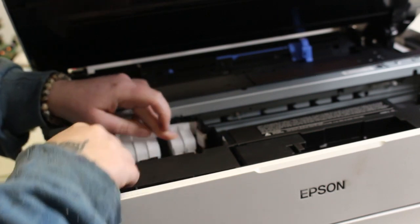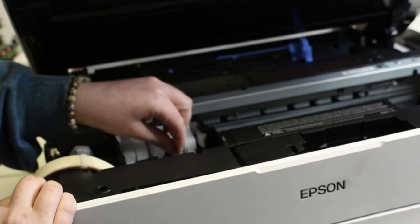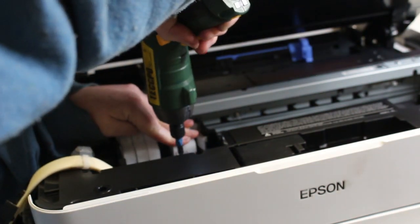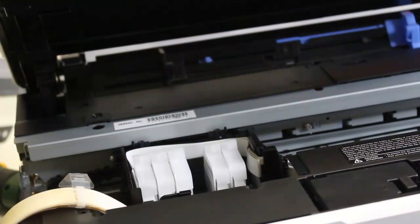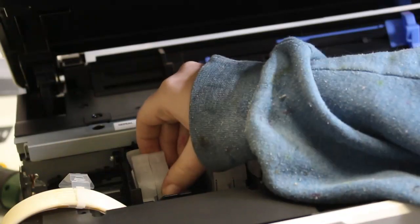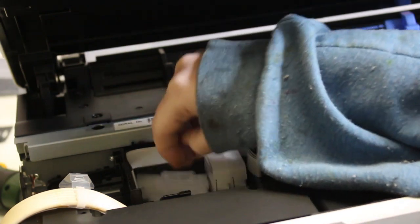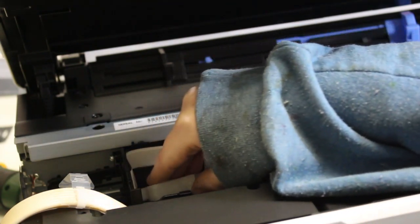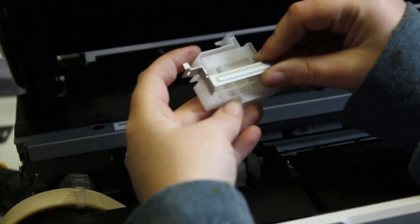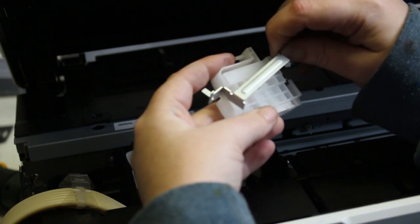Go in more towards an angle towards the back, right? So if you're holding the damper, hold it up at an angle, as if the back is facing angled down, and make sure that the tail is pushed all the way out towards the back. You're going to push in and then lay it down, and the top part of the bracket where the screw will go will sit on top a little bit of the screw hole. You can pull it out a little and then push it back in, and it should fall flat under there. It looks almost L-shaped once it sits under where the screw goes. So again, let's go through it, and then I'll show you better how to put the bracket in.